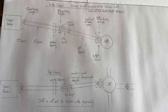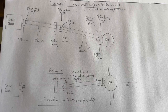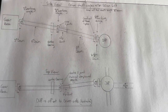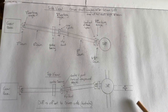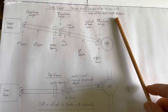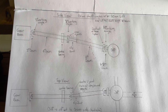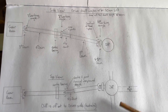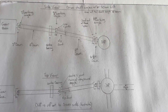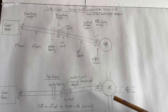This is something that needs to get right when you have a vehicle with a two-piece tail shaft. The first thing someone's going to say is just put a one-piece in there. You could do this if you had a bucket load of money. The overall length of this tail shaft is 1,636 millimetres — that's quite a long tail shaft to make as one piece. The Isuzu D-Max runs a one-piece tail shaft but it's a four-inch diameter alloy tube shaft, which is quite expensive to get made.